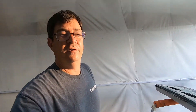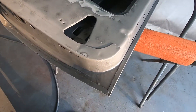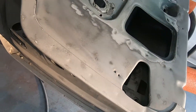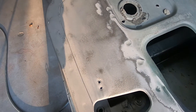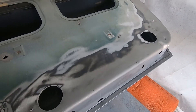The metal that I replaced was just out of caution to keep rust from showing up later after we've spent all this time doing this repaint. Here's one of the doors — you can see after it's sandblasted it's pretty clean, got right up in around those hem flanges really well, so that'll take epoxy very nicely. I went back with a dual-action sander with some 180 grit and feathered out what was chipped and rough looking.